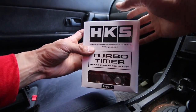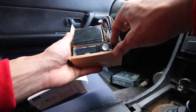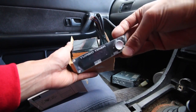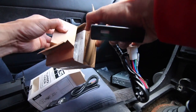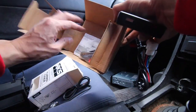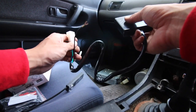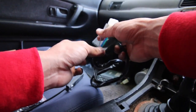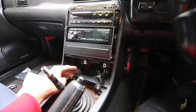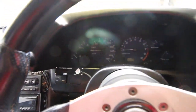Inside the box you're going to see everything you need to get this all started. The actual turbo timer display unit right here is going to plug into the ECU or the computer unit. The install is pretty easy since I have the harness already in. This obviously goes to your harness, and then you'll be utilizing the ground and just the gray wire — the gray wire is what goes to your parking brake signal. I went ahead and grounded the ECU of the turbo timer and mounted the turbo timer right here so it's not in the way of any of my gauges.